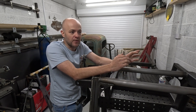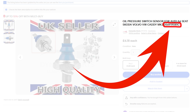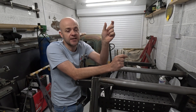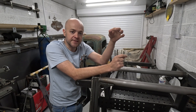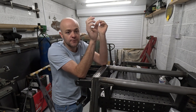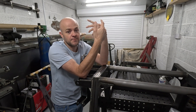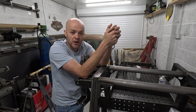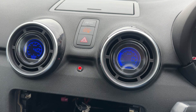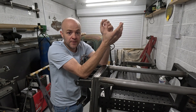I can't really get around the oil pressure gauge that way. The way I've done it is I've put a Ford Focus normally-closed switch — it's M10 by 1 thread — and you screw that in. You replace the wire: change the Fabia wire end to a spade connection as that's how it is on Fords, plug that in, then put the other wire to one side of an LED and the other side of the LED to your switch 12 volts. What that does is when you turn the ignition to the second setting, it lights up, and as soon as you start the engine and it senses oil pressure, the light goes out. If you lose oil pressure while driving, it illuminates again — that's how I've got around that.